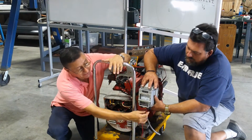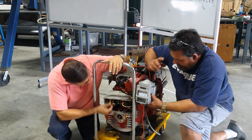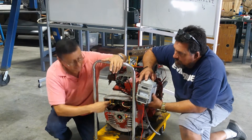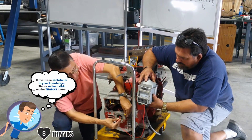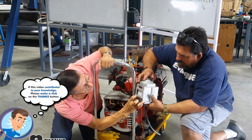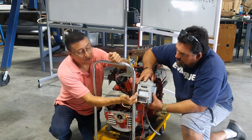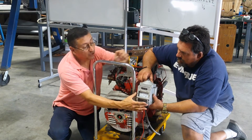Ready? We are going to check. This terminal will be connected to the ground — the ground is any part of the frame. The other one should be connected to the phase that I want to check. Okay, this is zero and this is infinite. We are going to check if the needle goes in this direction or goes to zero during the cranking.